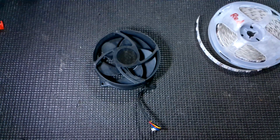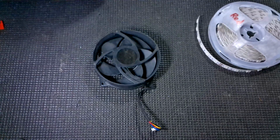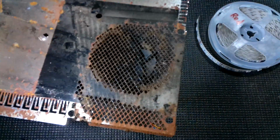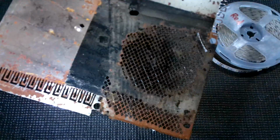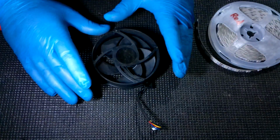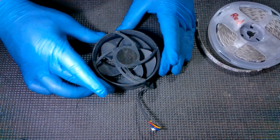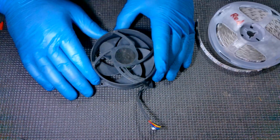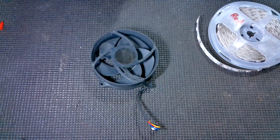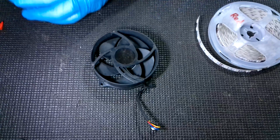Anyways, the other thing, a quick tip before we get started: we're actually going to do it with your case. Your actual outer shell of the console has a metal shielding on it. Here's just an extra one I've got laying around. It looks kind of like this, but it's attached to the actual top case piece, and you can see this one's gross. That metal shielding is something you're going to want to completely pull out. Now, you don't have to. You can leave that metal shielding, but it's RF shielding, and the vast majority of you don't even need that in the first place. What happens is that it blocks a lot of the light. So if you pull that off, you're going to get a much better and cooler looking effect from the LEDs, and again, it's not going to mess anything up at all. It's an RF shield, unless you have issues with RF signals where you live for some reason, which would be really rare. With that, we're going to get started with this tutorial.